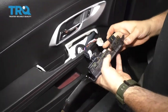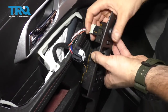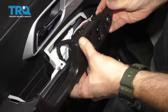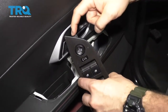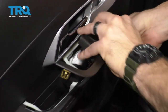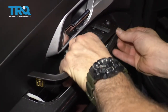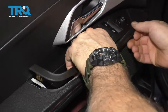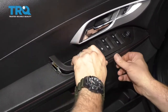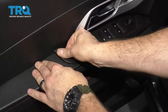For reinstallation of your switch bezel, start with the lighter colored connector — line up the spring tab lock and snap it into place. Followed by the darker connector — line it up and snap it into place. There is a tab here that we'll insert underneath this plastic trim, so put that nose in first. Make sure all of the trim is lined up, apply some downward pressure, and this should snap right into place. Work your way back, finishing with the last click.